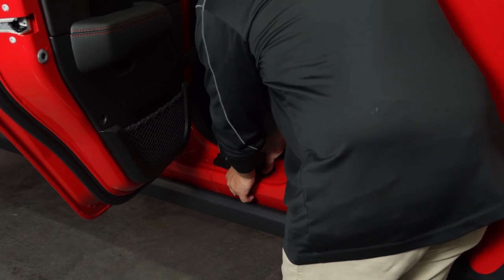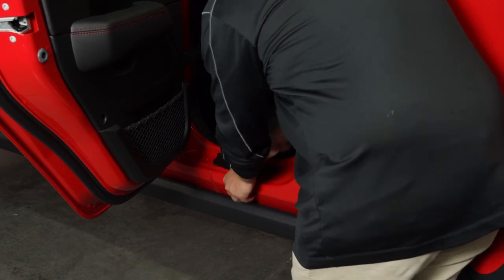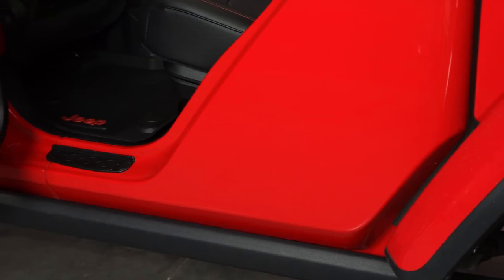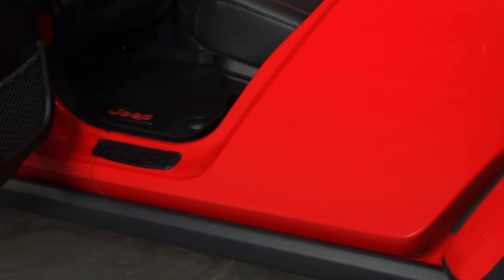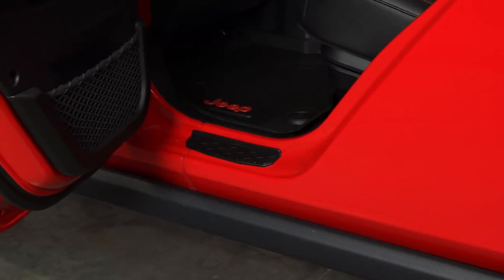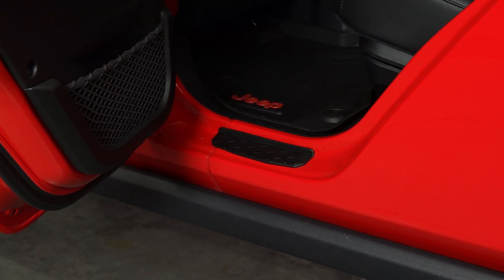Same thing for the front. Don't have anyone jump on this for a little bit — once the 3M is set up, these things are very hard to remove, but you want to make sure it's set up properly. According to the instructions, it likes you to do it between 65 and 95 degrees. So if it's super cold outside, the 3M will not stick. Pull this into your garage or wait till the summer or springtime and get that done.